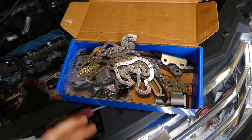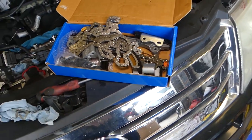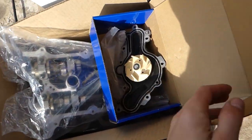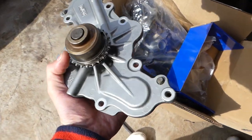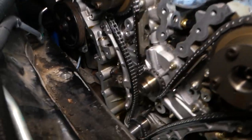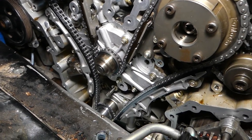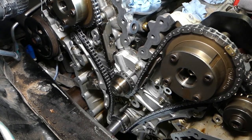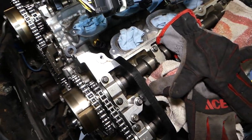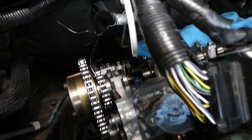This is the timing chain — the whole kit — and you can find it listed in the description below for your convenience. We also have a water pump, and I'd definitely recommend that if you're replacing the chain, put a new water pump in too. This is a timing chain driven water pump, and you don't want to have to do that job again — you'd have to remove the timing chains to get to the water pump. All tools and parts, including the pump, timing chain kit, and special timing tools, will be listed in the description below.